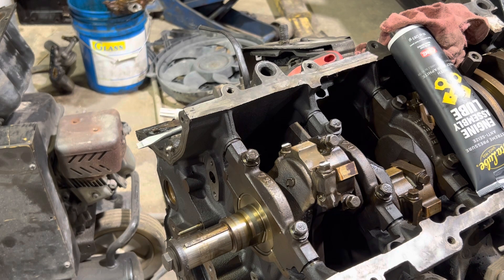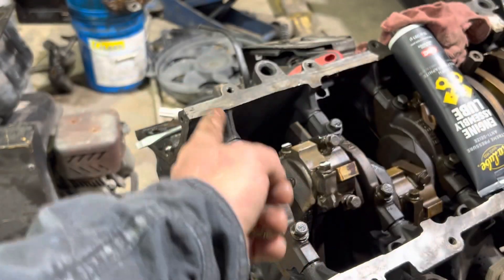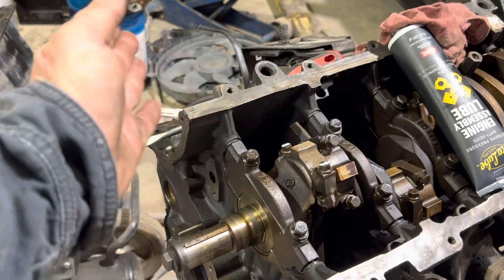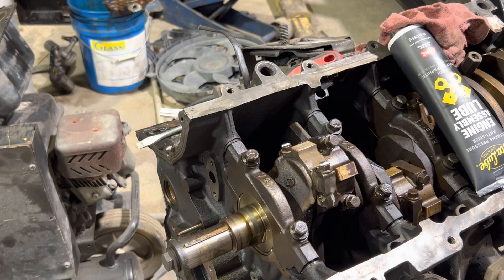It's 2023 and nobody's got anything in stock. I don't know how we ended up with a bolt shortage, but we got it. So I'm going to go ahead and do the rest of the rods and I'll get back to you once I roll this engine over. That's pretty much it: 18 foot-pounds for your first torque sequence, step it up to 30, and then your final 90 degrees — put a paint pen mark or whatever works for you. Just make sure you get your additional 90 degrees torque.